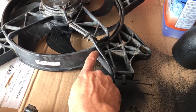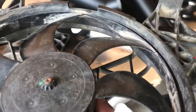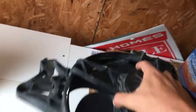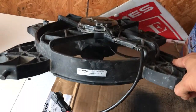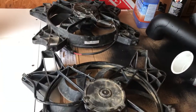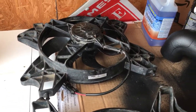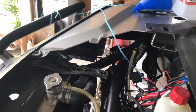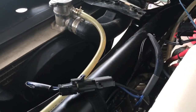Another concern was it would have been super tight — I probably would have had to notch a quarter inch out right here, which would have been fine. There is space to do that; you can see there are other places where it's been notched from the factory. I would have cut the pigtail too. I definitely would have liked to have that one in there, but without pulling the whole radiator out it'd be near impossible, and I didn't want to lose all my Engine Ice because that stuff is pretty expensive. But this fan is a whole lot stronger — it's like a small tornado underneath the hood.